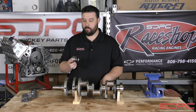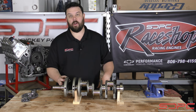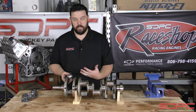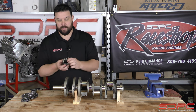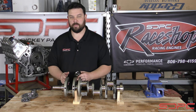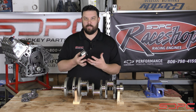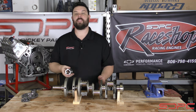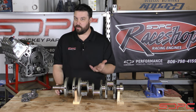If you take a stock OEM lower crank gear and press it all the way onto an LT crankshaft, it either will not go on all the way — which can cause issues — or if you try to force it on, the chamfer on the inside of the gear does not match the bigger chamfer on an aftermarket crankshaft. It can actually split one of these gears. If it splits, that causes problems with your oil pump, since the oil pump is driven off of this. Same thing with your timing chain — it could start skipping teeth, breaking, or falling apart.